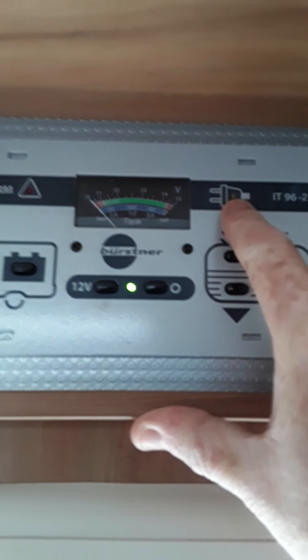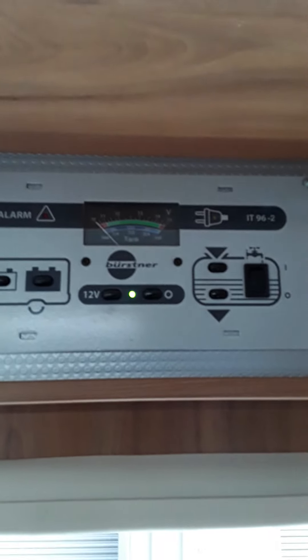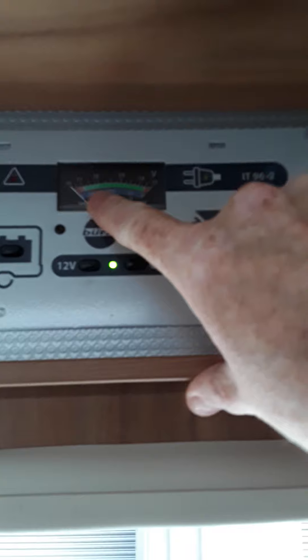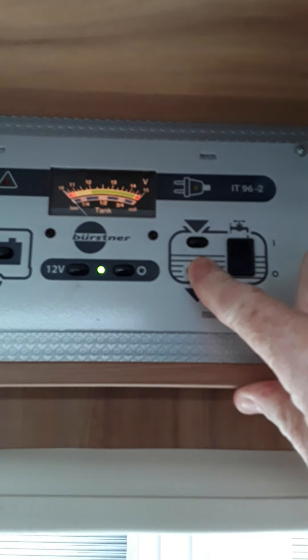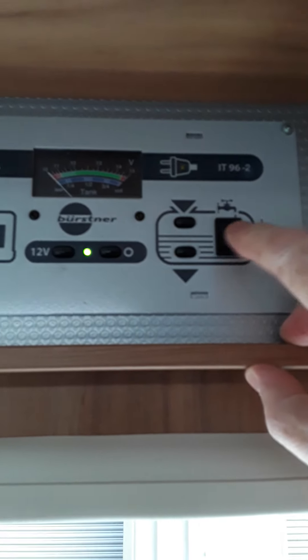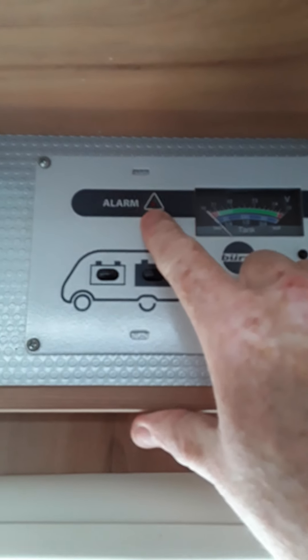We'll press the engine one and you can see there it's going up to just over 12V, and our leisure as well - that's working on the green gauge at the top. We're not plugged in at the moment. If we're plugged in, that'll go up to about 13.5V on both, showing you that it's charging. When you're plugged in you'll get the yellow light coming on which shows that your mains are coming into the van - just keep an eye on that on the campsite that it hasn't tripped out outside.